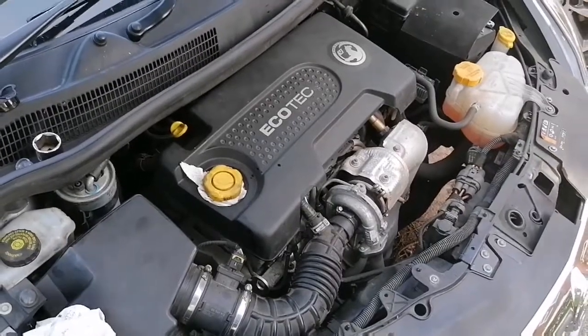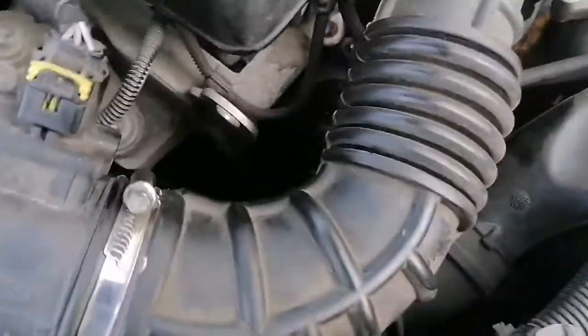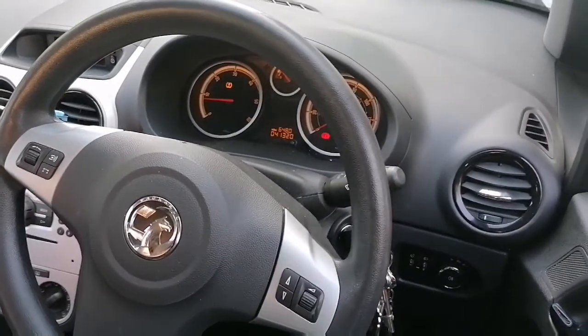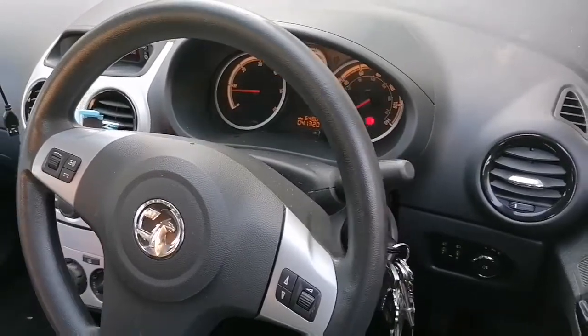What we're doing now is letting the oil filter fill up with oil for about 30 to 40 seconds. In the meantime we're checking for any leaks around the oil filter housing — and that's completely sound. On the dashboard we're looking for any oil pressure warning lights. Ignore the TPMS sensors — I just need to reset those. The oil service light is reset by the ECU.